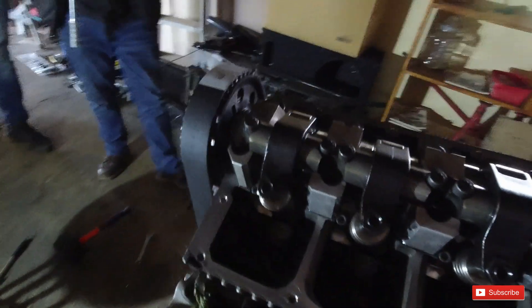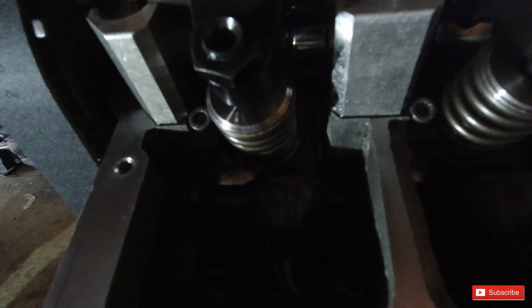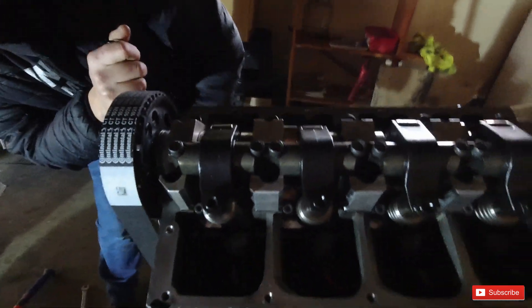We're going to be starting with the injector lashing. The first thing we did was to take out all the glow plugs to turn the motor over. The approach is going to be to turn the motor over, get the injector at the lowest point possible, and then basically tighten this bolt. Once it's loose, you tighten the center point with an allen key till it feels a bit tight, then 180 degrees back, and then tighten the bolt.